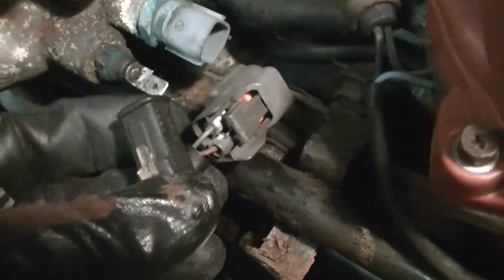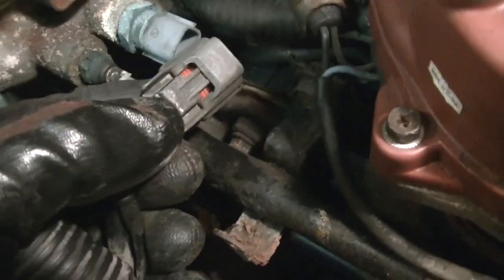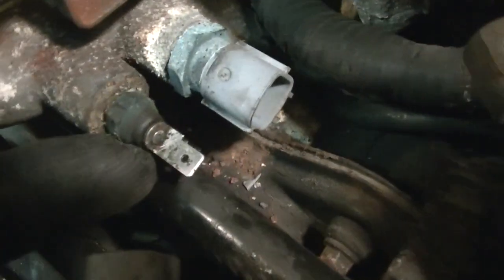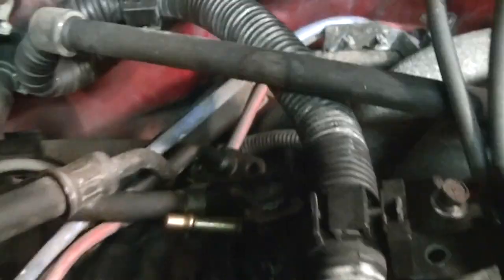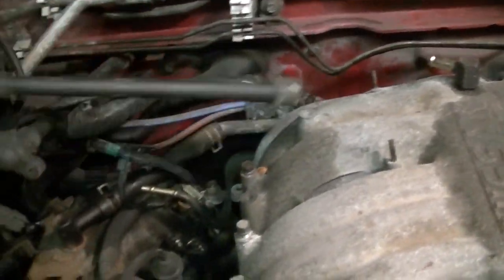This little tiny temperature sensor took a while — you just pull it off but you have to tug it kind of hard. The other connector has a clip you have to get your finger under and gently pull off. I also unhooked the wires from the distributor and pulled everything back. For the fuel lines — high pressure and low pressure — I disconnected the two little 10 millimeter bolts. Make sure there's no pressure on your hoses. The wiring harness comes completely out of the way.